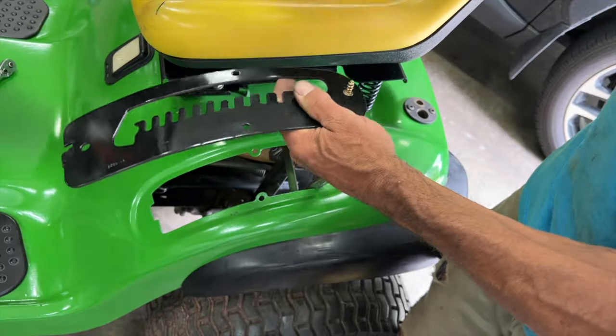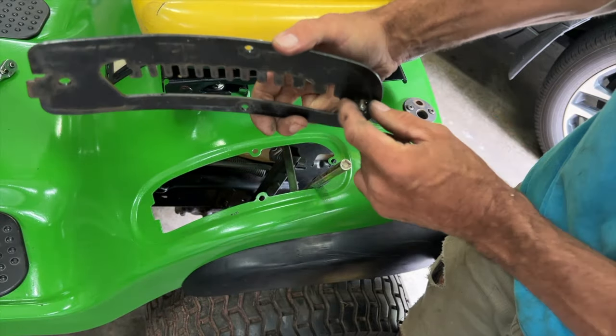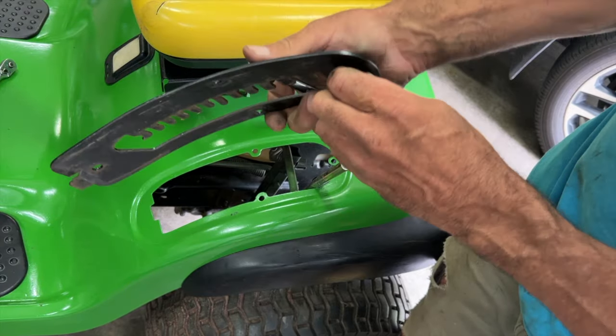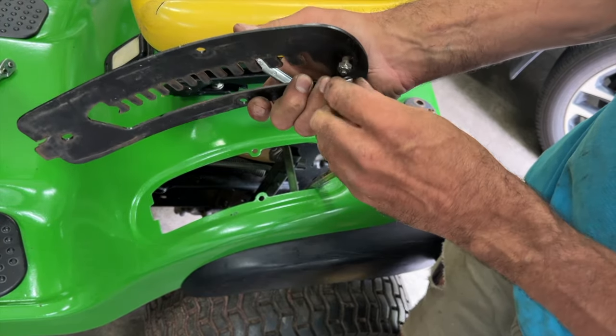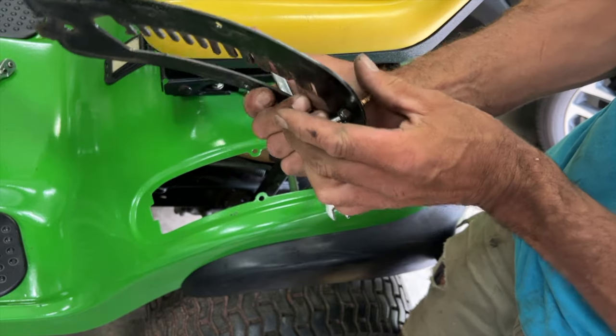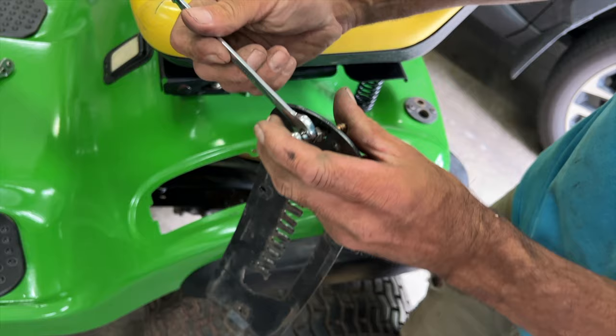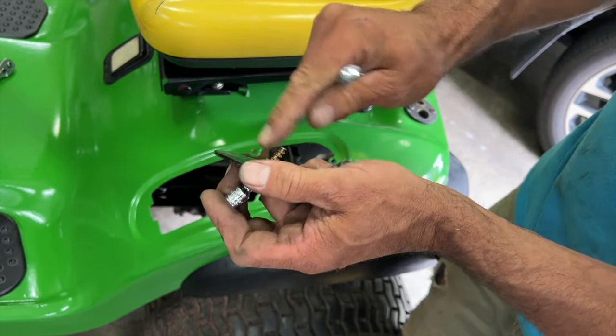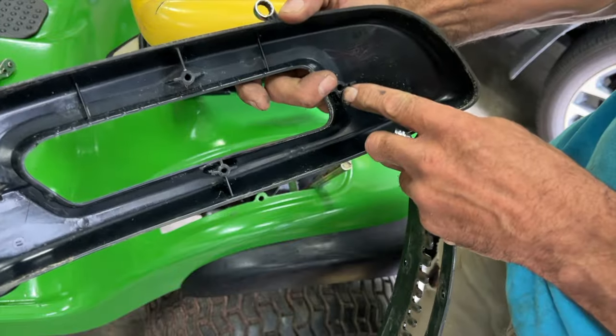When that's nice and tight, well, this nut needs to be adjusted in against here, the back side. So I'm going to hold the stud with the socket right here, just a hex on this side. Then I'm gonna take a 10 mil wrench underneath there and just gonna tighten it up like that. Cause I don't wanna turn this and it'll strip this out right here.